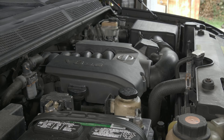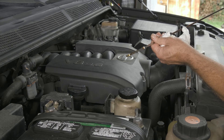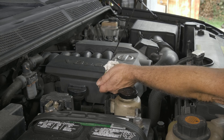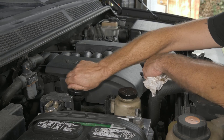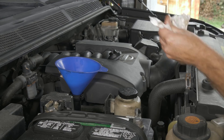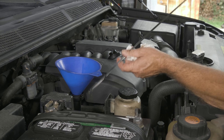I'm going to go ahead and start the motor up, let it run for a few seconds, and then we'll check the oil. We'll go ahead and check our level now. Looks like we were right in the middle. We'll go ahead and put a little bit more into it. So now we're about three quarts — that's pretty good. We're almost to our top dot. That would be our high mark of being too much, so we're all ready to go with that.